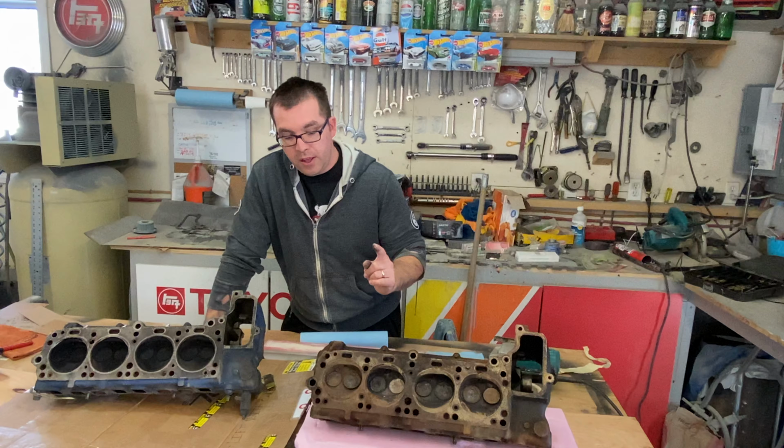So Kyle has, from what I understand, a parts car. And that's the first model year Celica. I believe it's a '71. And what the '71 had was an 8R-C. And I have the 18R-C. So the 8R-C needs hardened valve seats to work with today's fuel. But we're going to get into what makes this head special.